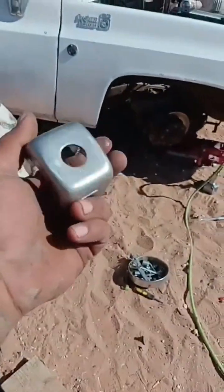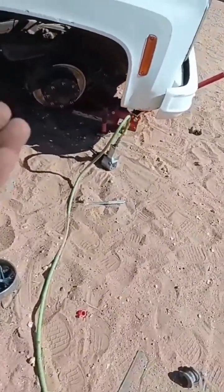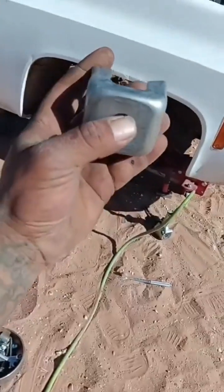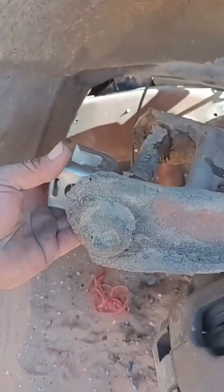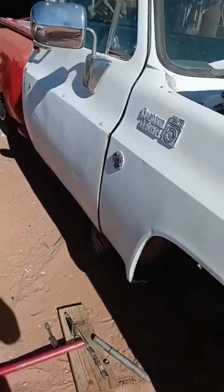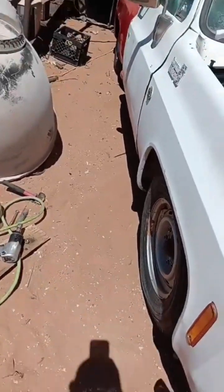That's actually the last set I have, but I had a gang of these. And these are just the perfect size for some reason, and they're reinforced and everything. You can just run this and then you run the regular shims with longer bolts. Put this in a runner right here like that. And that's gonna give you an extended control arm, bringing the tire like this when you slam it, having the right geometry, not wearing out your tires and all that. So yeah, we're doing that right now. You see now the tire's straight.